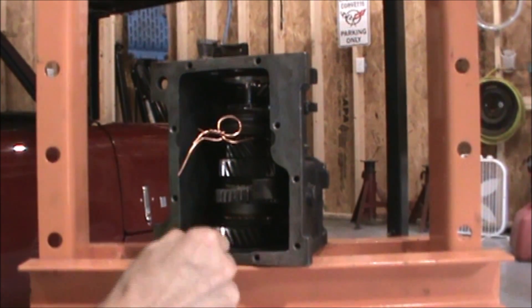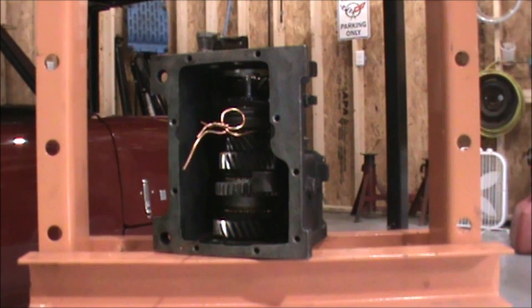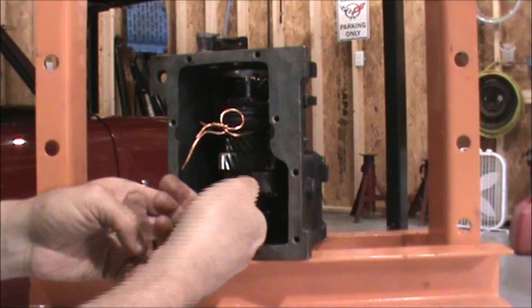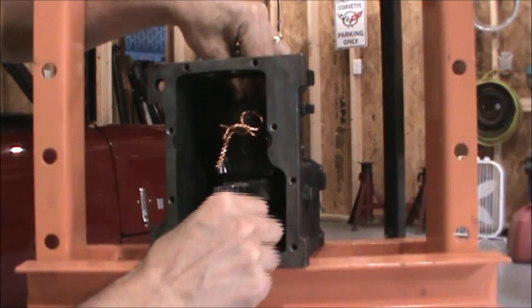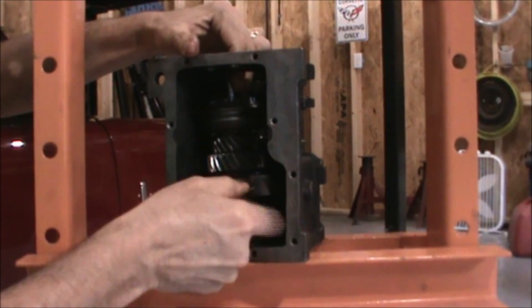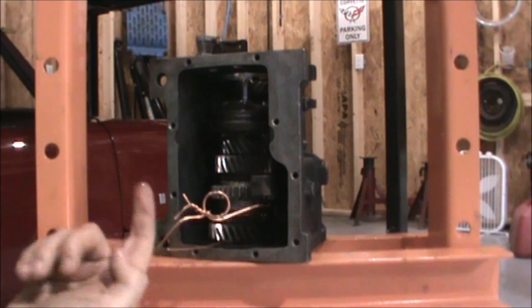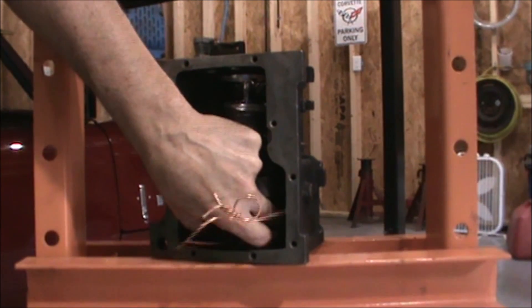While you're removing the wire, be sure not to lift up on the shaft from the bottom. What we're trying to do is make sure that the split ring we put in earlier doesn't come out. Always lift from either grabbing the nose of the shaft and pulling up — there goes a thrust washer, we can put that in later — but don't push up because it'll disengage the split ring that's buried inside of the gear train and you'd have to start all over again.